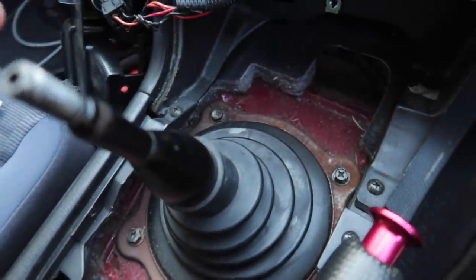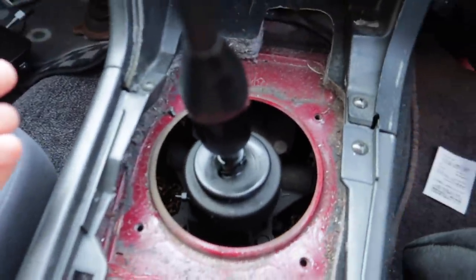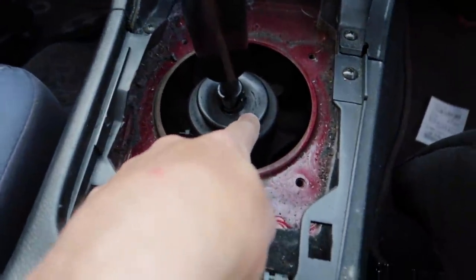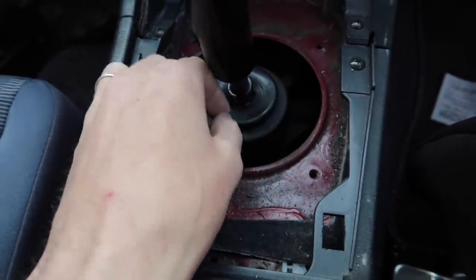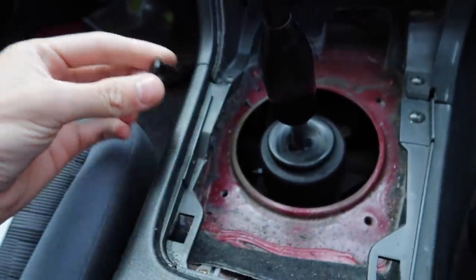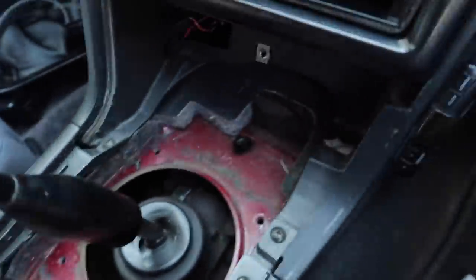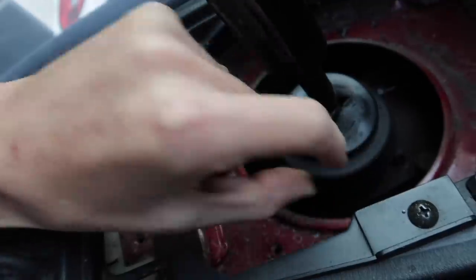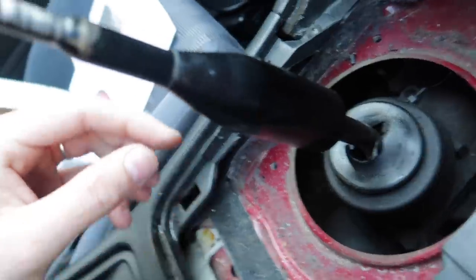So many innuendos in this video! And we can see the top of my transmission now. I can understand why there's a bit of a smell of transmission fluid coming in — that's going to need to be replaced. If you ever get the smell of transmission fluid coming into your cabin, this is generally why: this seal here breaks and splits. They're really cheap to replace — you can just get them from Nissan OEM. That's what I recommend.